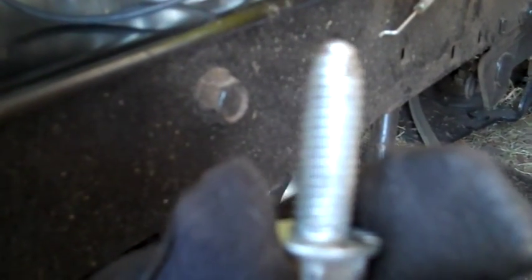Okay, so now you've got your new motor dropped down in position. Here's the next tricky part. Take a couple of screws or bolts and drop them down in the mounting holes to kind of hold the motor straight, because this next part's going to suck. What you're going to have to do is take the old motor mounting bolts, spray a little lube on the threads, because these are not threaded on this motor. You're going to have to force these screws up in there and it's going to be like tapping the threads on the way in. So it's going to be kind of a pain in the butt, but that's what's going to have to happen. Like I said, make sure you put a little bit of WD-40 or something on these threads, lube them up. That way you don't get as much resistance as they're going through.